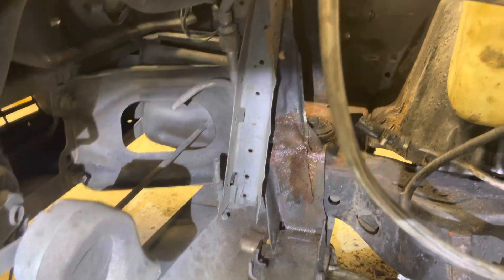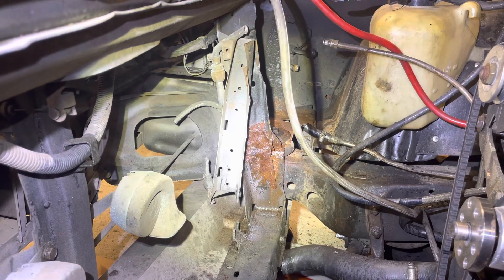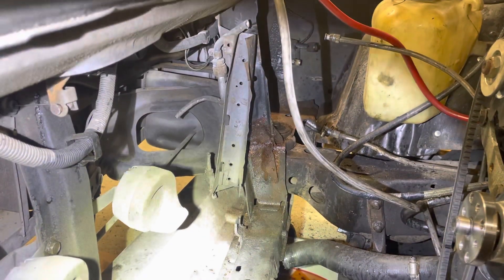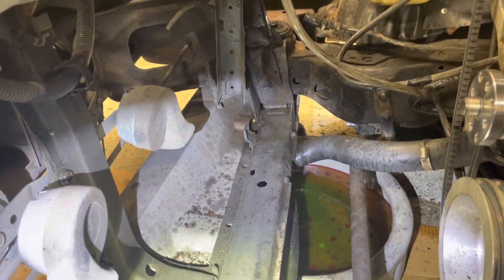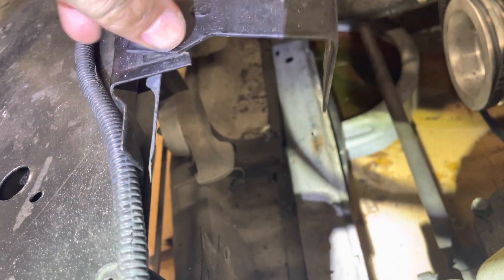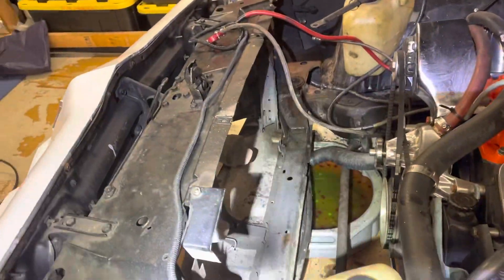You can see there's a little rust which I'm probably going to cut out. The vertical piece — I think this is the mount for the old air conditioner lines — I'm going to get that out of the way and order a replacement radiator. I'm going to try to get the mounts for the bottom; there was no rubber on the bottom, no side cushions — it was up against hard metal, rubbing. It's all wavy and wiggly. These brackets weren't the original setup — this is all that was holding the radiator from falling backwards. I need something that mounts here, there, and there, as a cap for the top of the radiator.